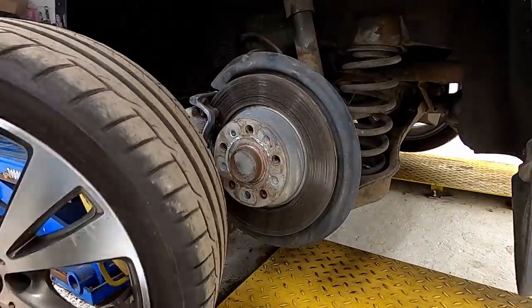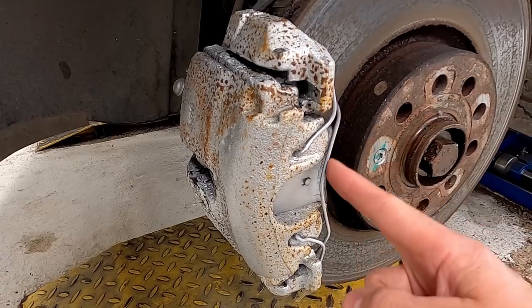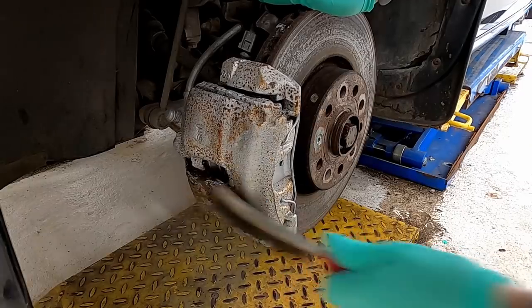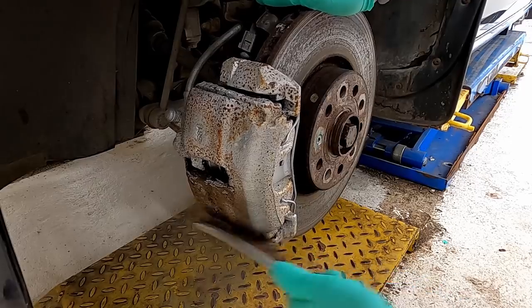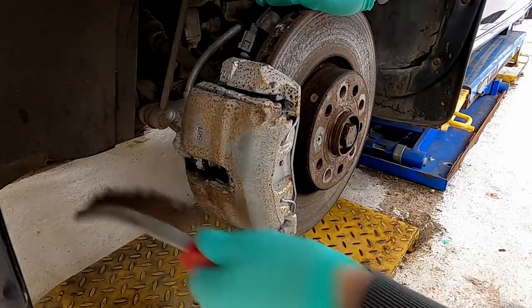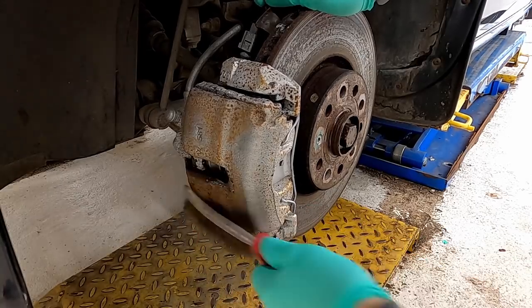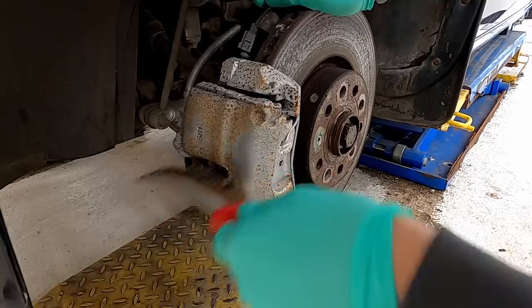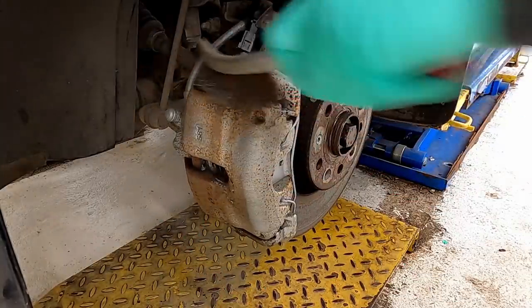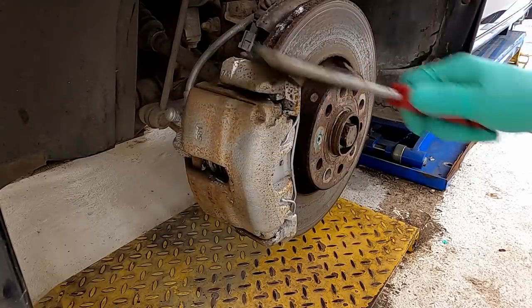With the wheels removed we can see that the brake calipers have already been repainted by someone else before. As I'm pointing to this spring clip here and the back of the pad, they haven't masked the area up and they've covered it with paint when they sprayed it. They've also got part of the brake line at the back and the bleed nipple covered in spray paint, and in the groove where the disc is there's a rubber boot which has got a bit of paint on it as well.